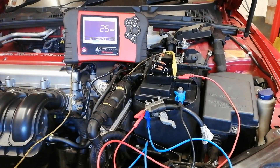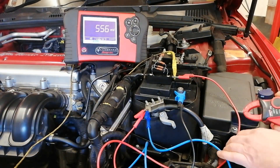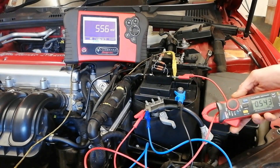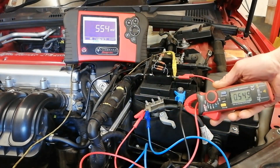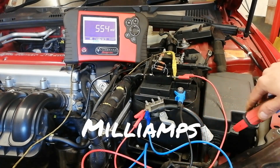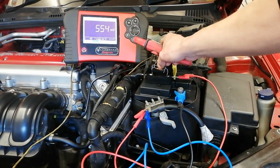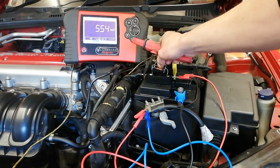I'll put the interior light on now. There we go — it's reading 556 millivolts, so that translates to around 550 milliamps. We'll just turn that off. Those resistors are a wee bit over their rating but not warm.